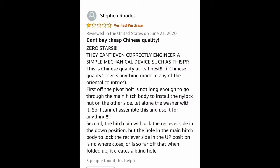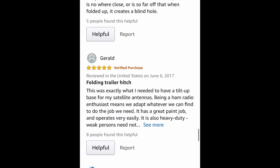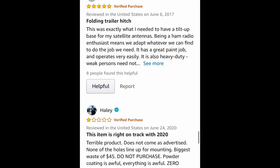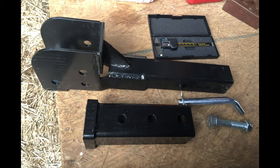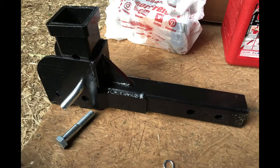Specifically what I found is that there are three holes in the receiver hitch's smaller section, and those holes are supposed to line up so that you can swing it up vertically or fold it down horizontally. There's a 5/8 pin that goes in there that works either way, and a bolt that goes through to hold it in there permanently. The bolt has a nylon section so that it cannot vibrate loose — it seems well designed in that way.